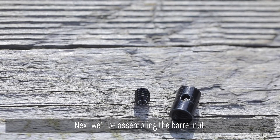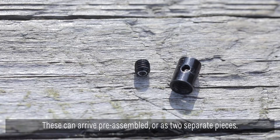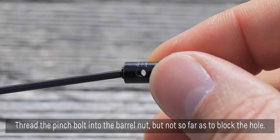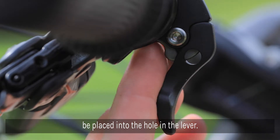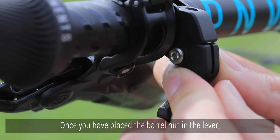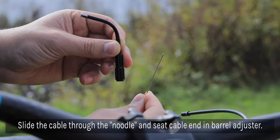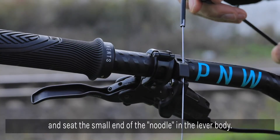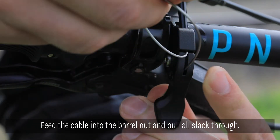Next, you'll be assembling the barrel nut. Please note that these can arrive as two separate parts, or sometimes the pinch bolt is already installed into the barrel nut. Thread the small pinch bolt into the barrel nut, but not so much that it blocks the hole. Using your finger, position the metal plate so that the barrel nut can slide through the hole in the lever. The metal plate is intended to guide the cable as you press the lever. Rotate the barrel nut so you can see the hole through the cable channel — you will be feeding the inner cable through this hole in a few steps. Slide the cable through the noodle and seat the cable end into the barrel adjuster. The small end of the noodle feeds into the lever body. Feed the inner cable through the hole in the barrel nut until the housing is firmly seated into the barrel adjuster.